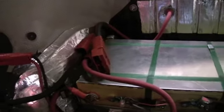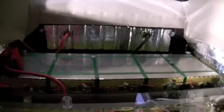Five are horizontal, encompassed in one-eighth inch sheet aluminum plates. The negative-most terminal is here, positive-most terminal is here. Right off of it is a 500 amp fuse. The lithium BMS — the brain for it — is back here, the controller. Little grey wires run to each bank. There are four banks of cells: one bank here, two banks here, fourteen each, one bank there of five, and the front is a bank in itself.